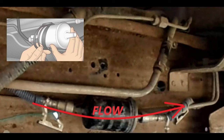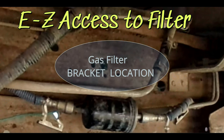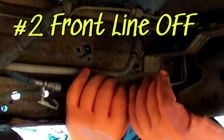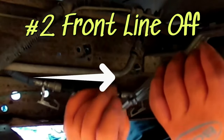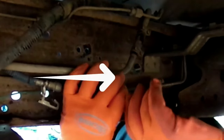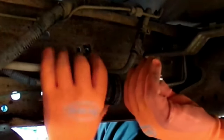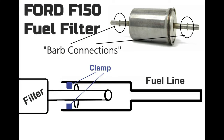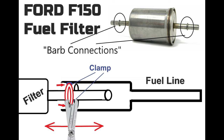Having the bracket off will allow you to swing the filter and the fuel lines down. Remove the two secondary clamp clips. This is by far the most difficult of all the procedures. You are going to insert the tool in between the line and the filter and push the line off the filter. This requires a little bit of strength but mostly finesse — make sure you get the tool inserted correctly and then push forward.